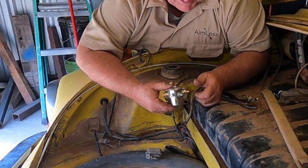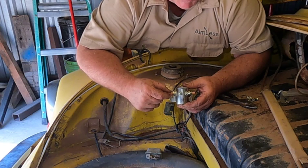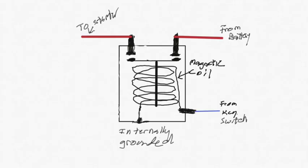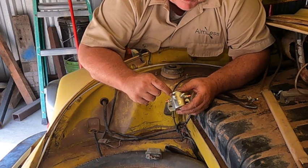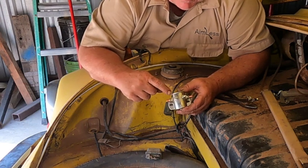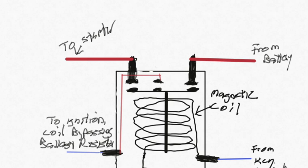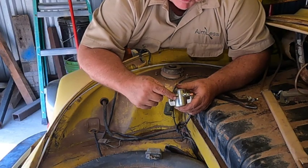The way it should work: you've got hot here and whatever goes on to whatever you're trying to energize. On the signal side, you get a signal from the key switch that closes a coil inside and closes contacts, which allows electricity to flow from one end to the other. On some automobile relays, there's a second post — on older vehicles that's used to throw a full 12 volts to your coil, bypassing the ballast resistor.